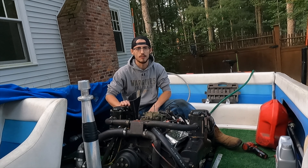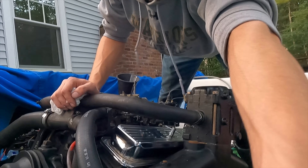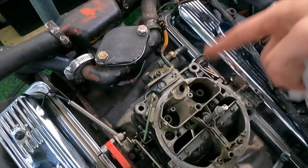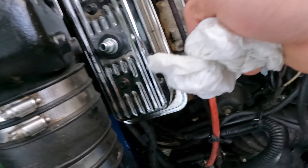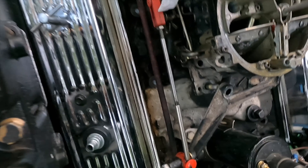You can't really supplement time or knowledge. Unfortunately, you're going to have to take off the carburetor to do this job — that's this guy right here. We already got our four 12-millimeter bolts out, so this thing is just loose up here. We've disconnected our fuel line, and I think I can leave the throttle body and everything attached if I disconnect the spring.